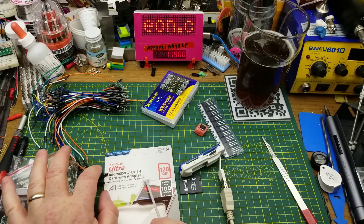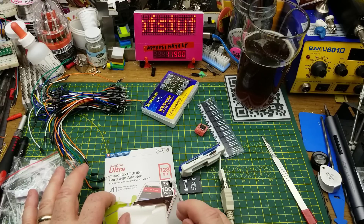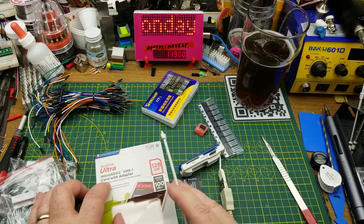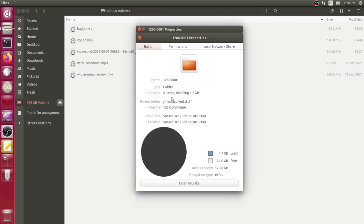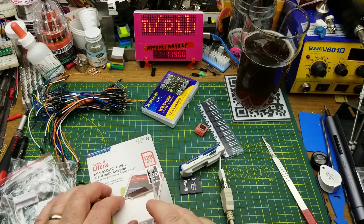General stock of consumables as usual. As for the SD card, I still don't know if it's legitimate or a scam. The fake ones often have much lower capacity, and when you start dumping files and try to read them back it just fails. That's why I'm throwing several gigs of video files onto it. The file system shows 4.7 gigs copied so far — it's going to take hours and I'll update you later. I'll put an update in the description.